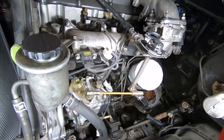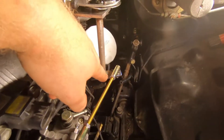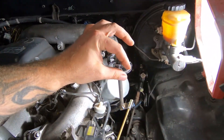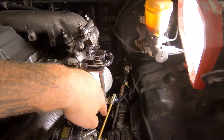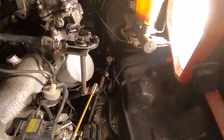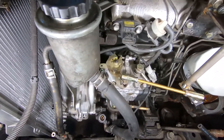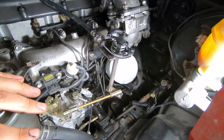One other problem I ran into was that when I had welded this bottom piece down, before I had it coming out over here and it worked and hooked up, but when you went inside there was barely any pedal movement — like that much pedal movement inside the truck. So a little engineering: I actually just turned this bar and angled it more out so that way I'd have more travel for the throttle pedal, and that cleaned it all up. Now I've got full throttle pedal movement and full throttle movement at the injection pump as well. So that takes care of the throttle cable system.